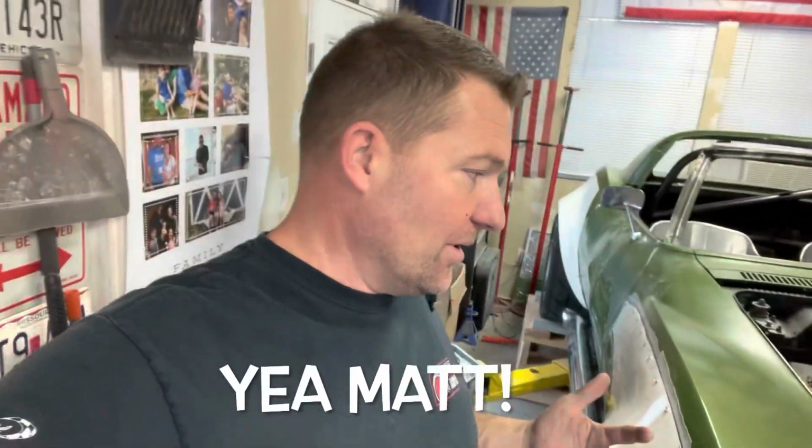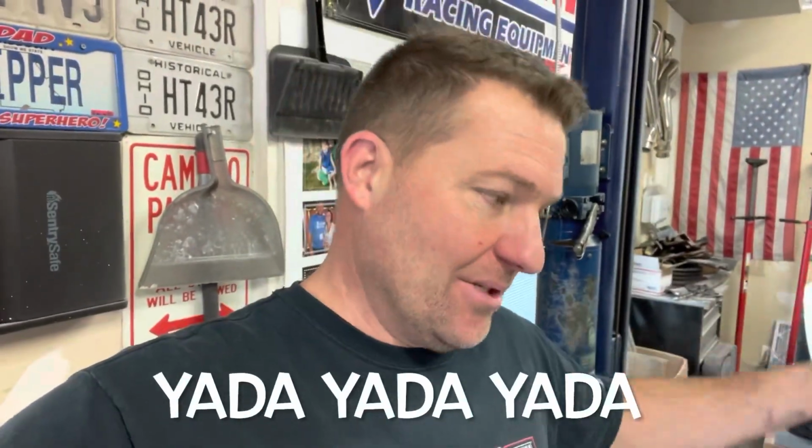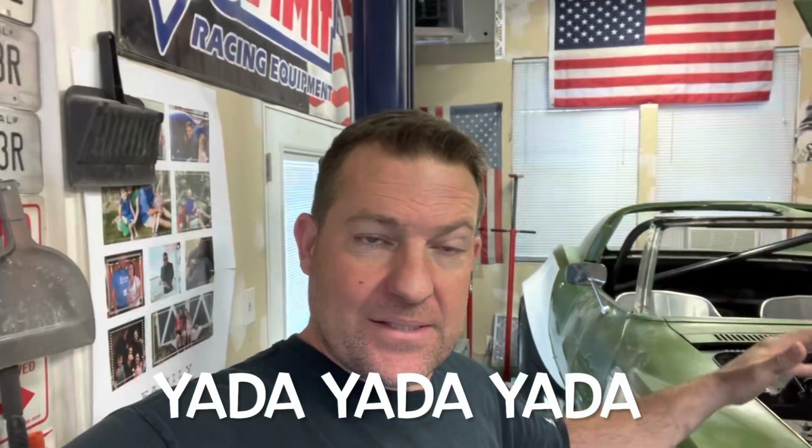All right, so I've attempted to get started on this probably two or three different times, and every time I start, I stop and I start trying to wrap my head around the solution, and halfway through coming up with a solution, I go back to trying to reevaluate the problem, and I'm going back and forth and not making any progress. So I called my buddy Matt and ran him through the gamut of information. This is where the body sits on the chassis, this is how many shims I have, these are my measurements. This is what I'm off. It's not an inch and a half, it's only like 3/4 to an inch. But visually, it looks crazy. It looks way more off than that.